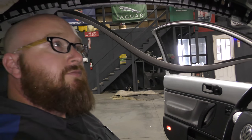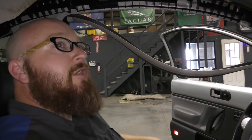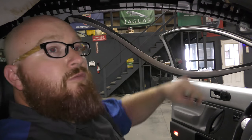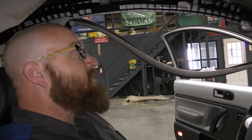It kind of sounds like that Jeep we used to have — an '06 Jeep Commander. We were out shopping one day and it literally started Niagara Falls raining on us inside the car, all because these little tubes were clogged up with debris. So make sure you take the chance now to clean those out on whatever car you're working on. Don't miss that chance.